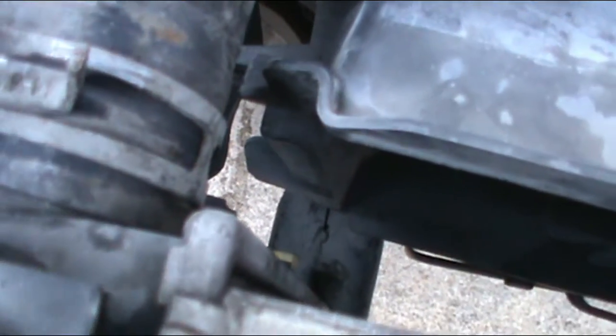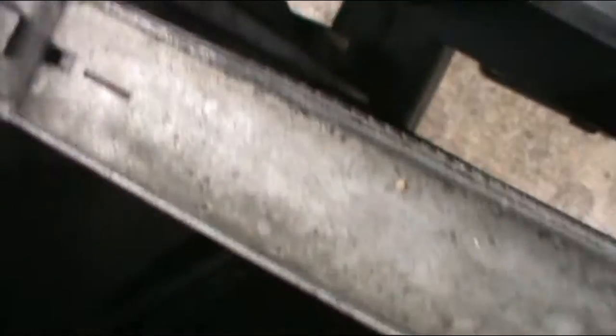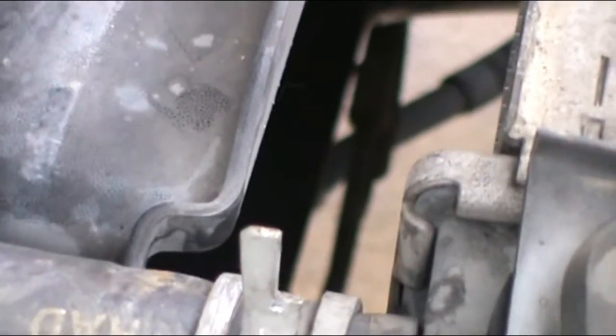As I mentioned, if you don't see any water leak from the hoses and you can see it right down there dripping, most likely it's your radiator that's gone and it needs to be replaced. I assume the hole is right there in the bottom corner — I can see the water dripping there really bad. I don't think it was the flush that did that; I think it was just time for the radiator to go because it was clogged. So I am going to go ahead and replace it — I'm going to order it online and whenever it gets here I'll do the replacement.